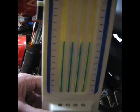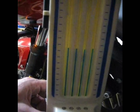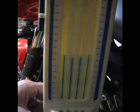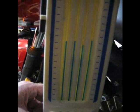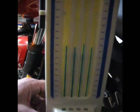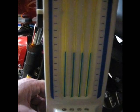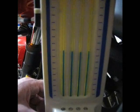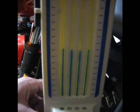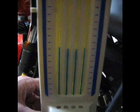Now I've brought number four up and we'll do a couple quick blips of the throttle. It's important not to close the throttle fast. If you do, you'll create high vacuum and that will suck all this fluid into the engine and out the exhaust. Then you want to evacuate the garage and you'll have to go buy more fluid for your carb synchronizer. So don't do that.